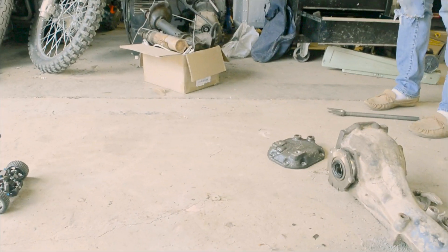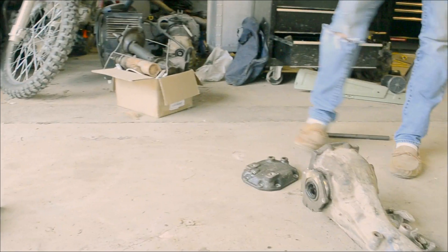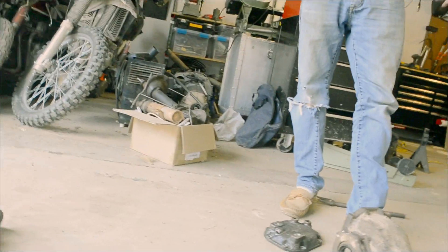As far as the axles go, do you have to make any changes at all? No, not if you're just swapping this R160 for this R160. There probably are variants of this set up for different axles, so you'll have to watch for that. But for this particular swap, the stock axles work just fine.